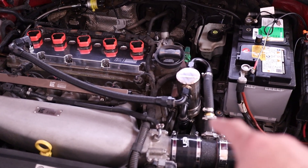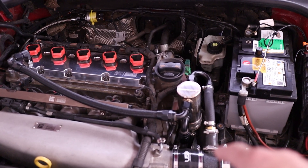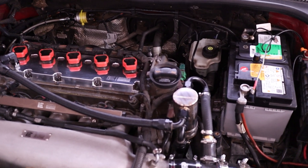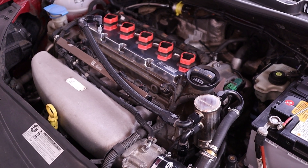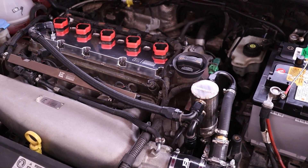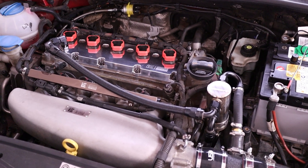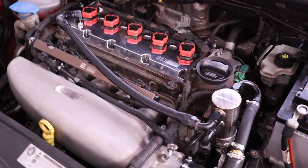And then I have this ran into the vacuum line going back into the intake, so it's just recirculating back into the intake. You can just put a filter there if you wanted to vent it to atmosphere. Definitely a good setup to get rid of that prone-to-leaking PCV valve. And it just looks super amazing. So check out the links below. Also check out boyjrc.net for some killer Volkswagen apparel shirts and stuff like that. We'll get this install started.